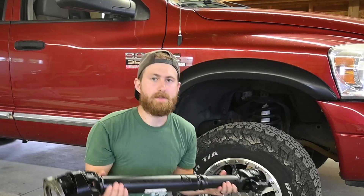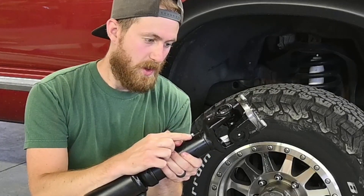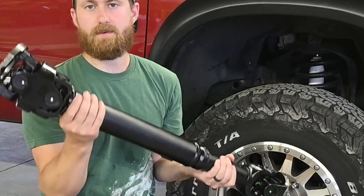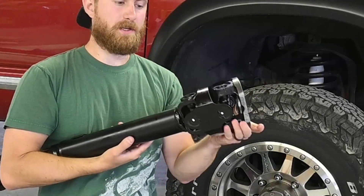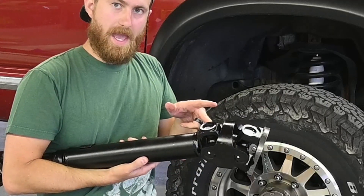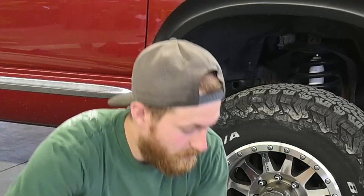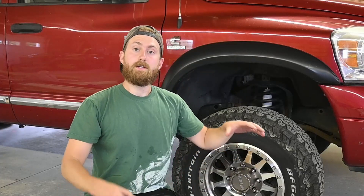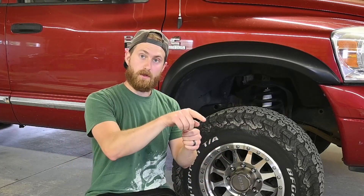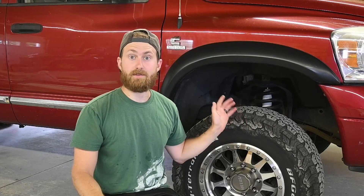This is the new front driveshaft I have, but just to use an example — this is the kind of grease fitting I was looking for. But in this joint up here, the part that goes up towards the transfer case, there is actually a needle grease fitting within it. It's basically a small hole that you need a special fitting for — push it in, line it up, and put grease in that way. Since I've had this truck, I have been neglecting to grease it, which may be why I'm hearing some noise.